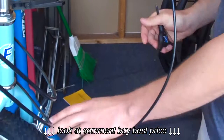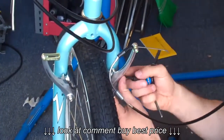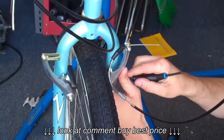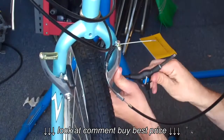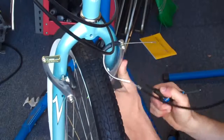Take your 5mm Allen wrench down to the pads. Regardless of the setting they come with, you always want to loosen them completely. Then push the lever in and make sure the pad is nice and flat against the rim and also parallel with the circumference of the rim.